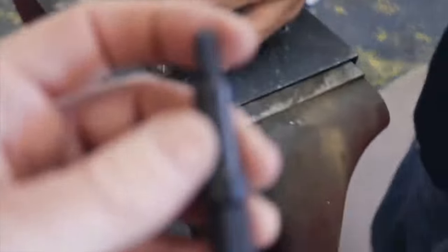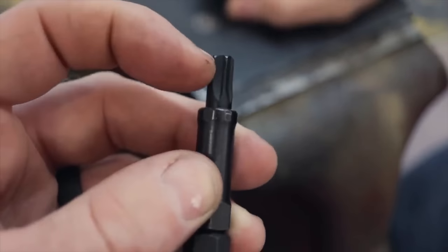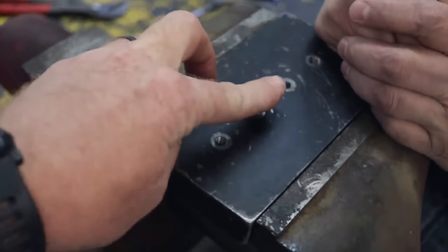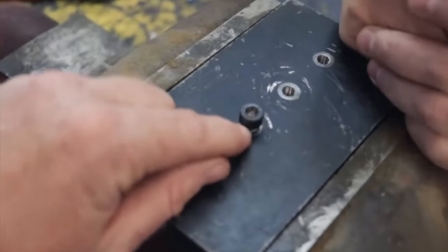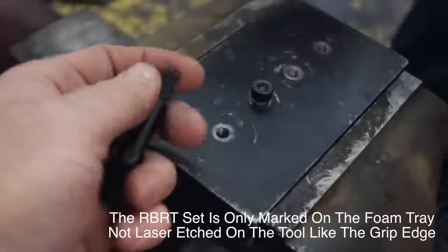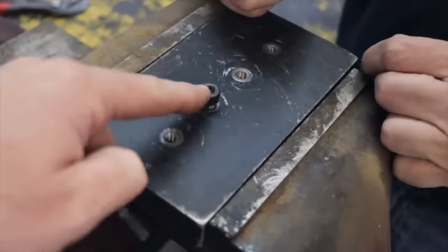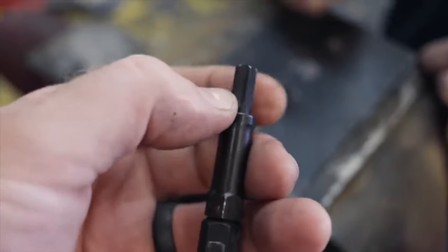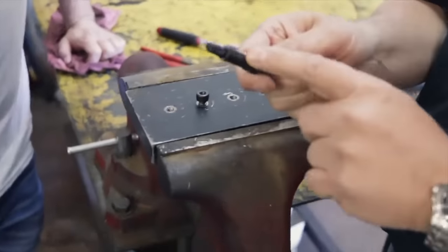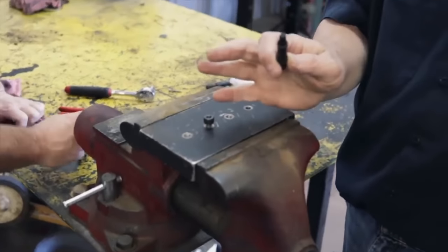That is amazing — and you can do that right at the car. It shows how deep it bites. That would be the broken bolt head in the part you're working on. You would drill a hole, and the drill bit sizes are marked right on the foam tray — it takes the guesswork out of what drill bit to use. You want to drill out the bolt and drive this in as far as you can because the deeper it is, the more surface area it's going to grab. That sleeve also performs a couple of other really neat functions.